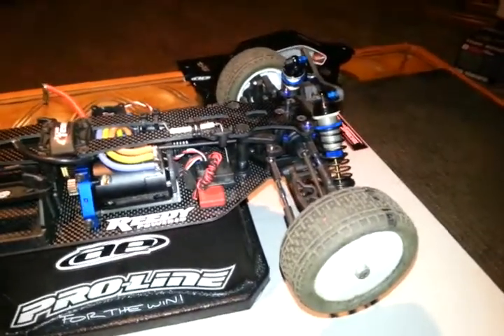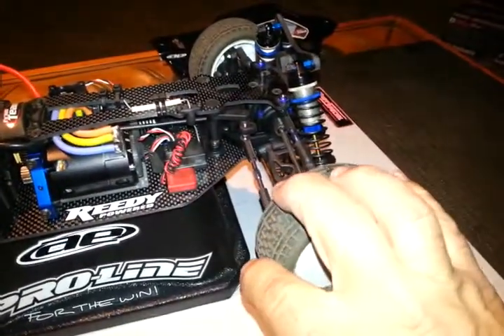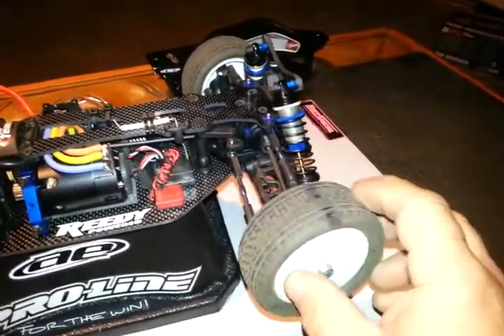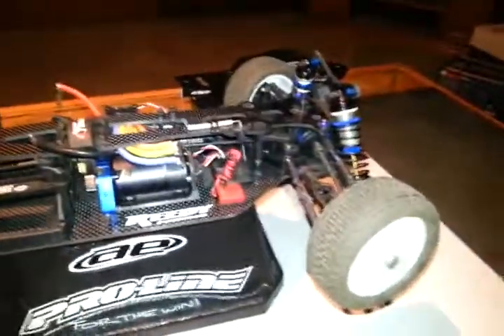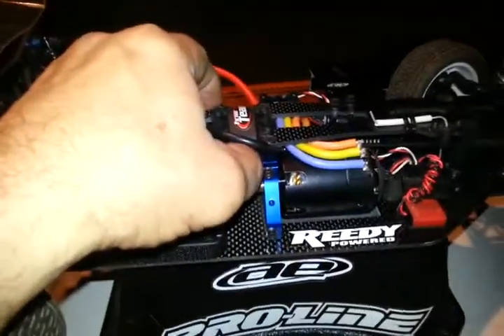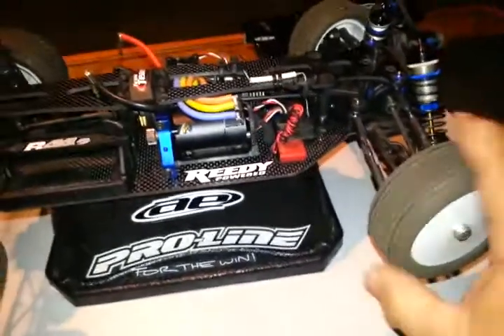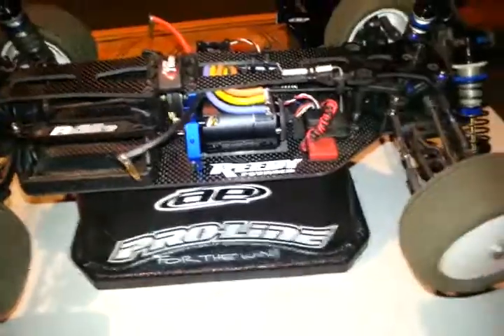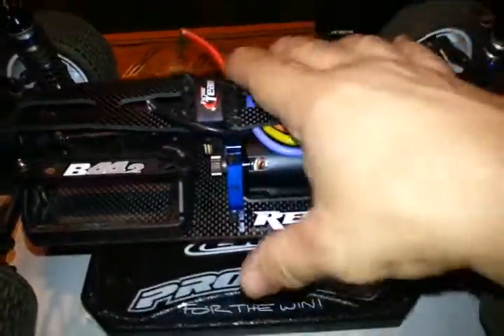The front is 100% the way the box tells me to build my diff. That's the way I always run my front — it's consistent all the time. Now, let's say I tell you I spun this and it was half a rotation — I just slung it and it stopped right there, half a turn. Well, that would mean my diff was really, really tight. And I would have to hold the spur gear in order to spin the tire, because that magnet doesn't have enough resistance for that.